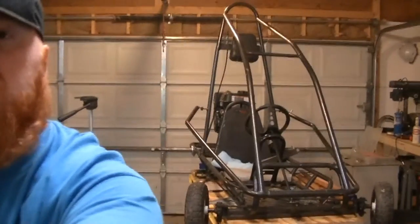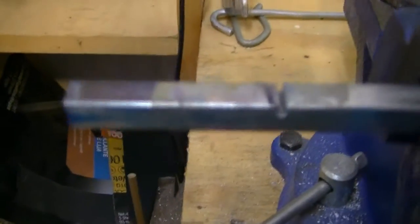It's been a couple of days since I made the video of my daughter and me working on the go-kart. I don't know how well I explained it, but we had to take the axle off because it had a coat of paint on it — the tolerances are quite tight on the disc brake and such. We took it off, had her sand it, and now the axle is on. I'm cutting a piece of keystock and I'll show you how. I put a leather glove in my vise and got the keystock in there so I won't chew it up, since it has very tight tolerances. I marked it and I'm cutting on the opposite side of my mark with a standard hacksaw.